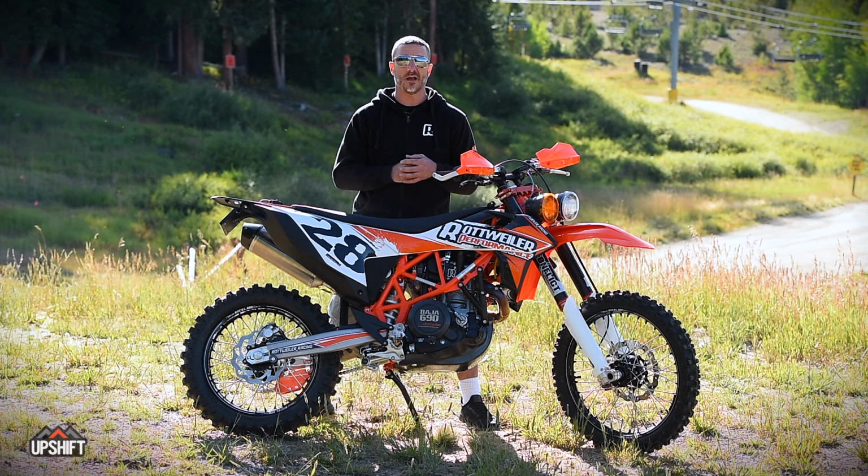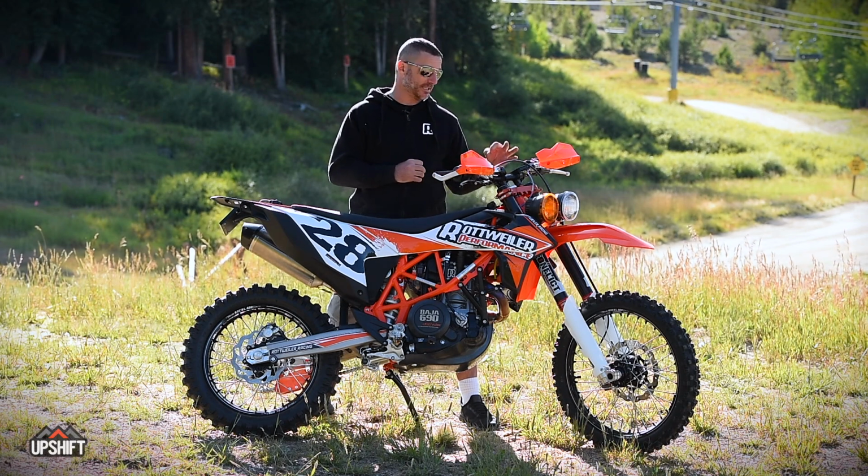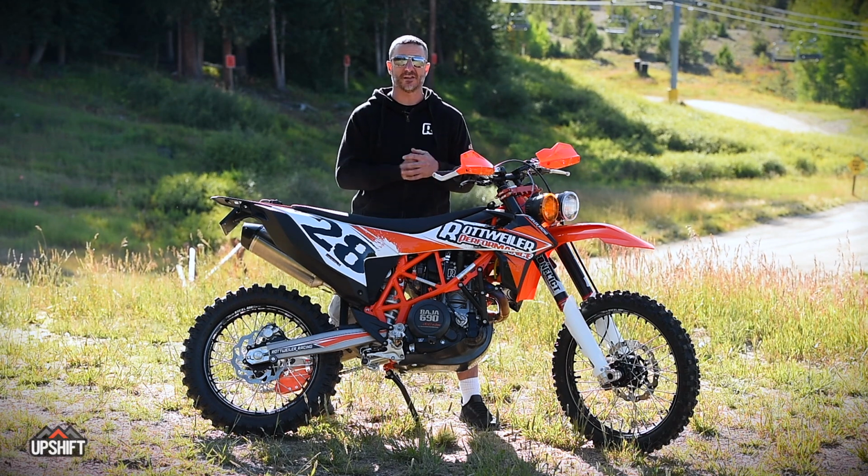But the custom mounts we made in about 6 hours from design to finish, printed a set, tested the printed set, and we actually integrated the brake line guide in the left-hand light mount, you know, to kind of clean everything up and keep everything light.